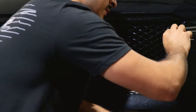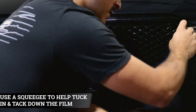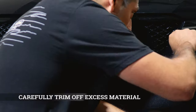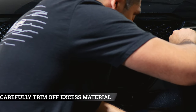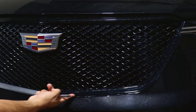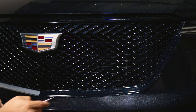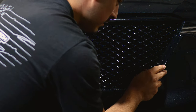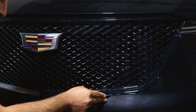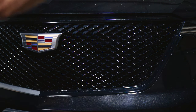Around this area, tack down as much as you can. You're going to need to lift the film and tuck it in to cover the inside of the chrome — after that everything else will be excess material. Once you've secured the whole panel and made sure everything is covered, come back and trim off all the excess material. Trim off the excess material underneath as well — there's a small gap where you can insert your blade and trim. Take your time and continue until you reach the edge, then remove all the excess material.